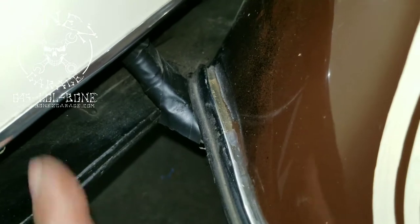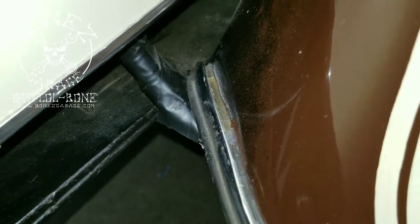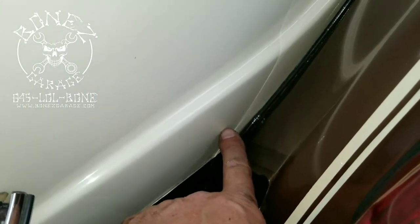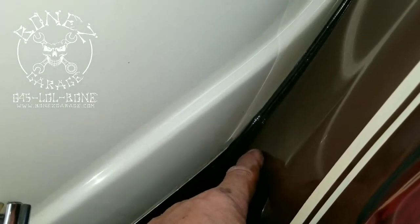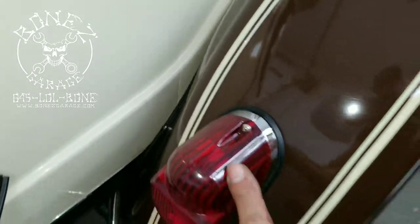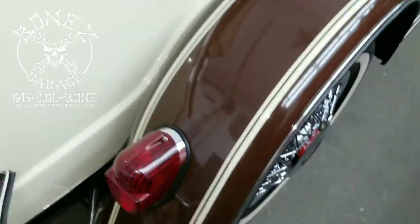This is your wire harness for your tail light, and that is the leaf spring, that's the fender. So again, we're going to put a hole somewhere over here in the car, run it through into the fender and then mount it right over here, then bring it over to the tail light so it stays out of the way of the wheel.